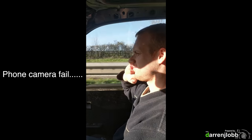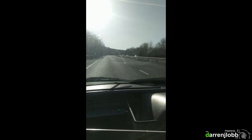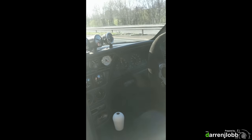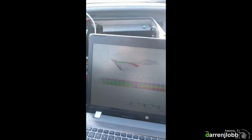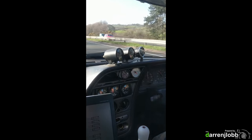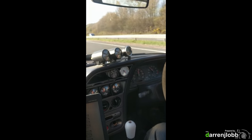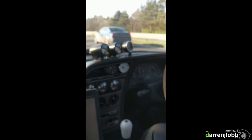Right, well you might notice Chris is at the helm today. We've been on a test drive up to the Fisheries today to work on one of the other cars. We thought, well, Chris better get some driving experience — bear in mind he hadn't driven this car probably for about five years and never with this engine. I've decided it's a pretty good opportunity for me to do some of the mid-range tuning, because I've never really done anything other than the wide open throttle stuff on the dyno. So we're just working on the timing table a bit here now — we've got plenty of time while we're under cruise. It's making more noise than it needs to be, so we're just making some adjustments. Got the engine in tune, Ruins turned it back up — it's cruising on our way back down to Cornwall now. Everything's going okay so far.